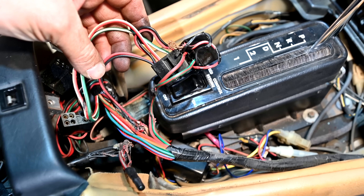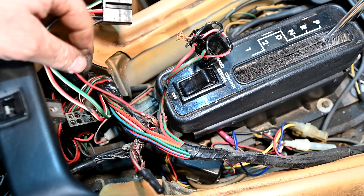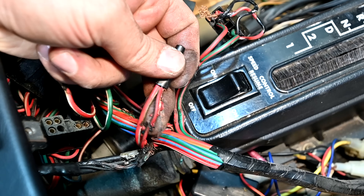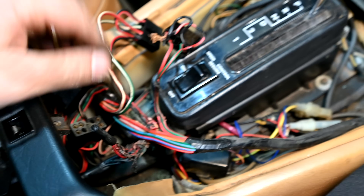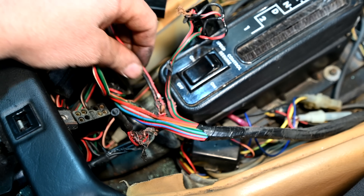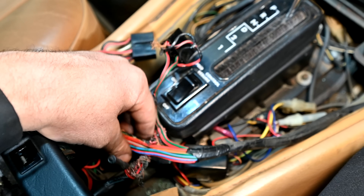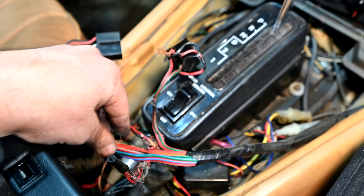Don't keep popping in fuses when your fuses blow. This is on the lucky side — it's fairly easily accessible to fix and it looks like only two or three burnt wires — but if your problem is difficult to get to and affects drivability, your car is going to be out of commission and fixing it is going to be difficult. After spending about half an hour removing all the electrical tape, it's a disaster — we need to repair more than two or three wires. The good news is I found where the split goes: it comes from that fuse and splits into two, and the main wire bringing power from the fuse is still in good condition, but the other two wires are damaged.